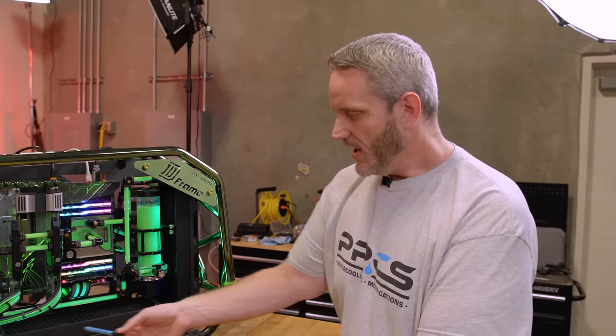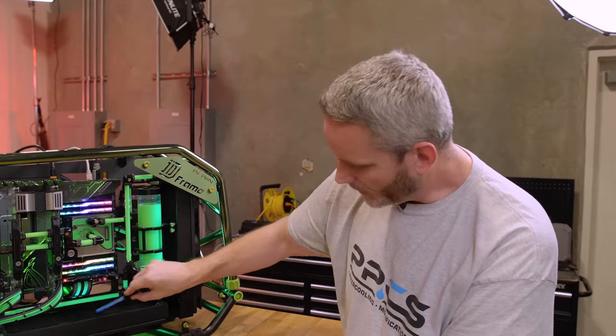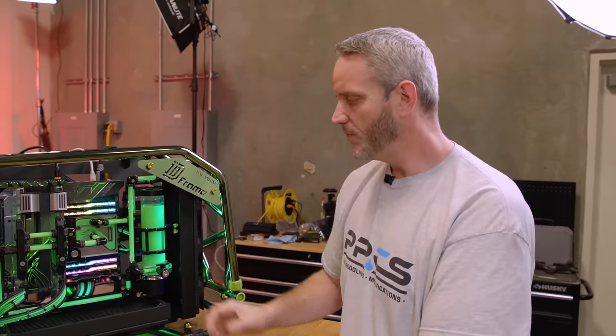and the radiators. That's the other thing people tend to forget about: there are thin rows that go down the radiator, those are referred to as rows, and that's where the fluid flows through. And that's thin and restrictive as well. And it's rough in there because it's just brazed copper, right? And so it's not real smooth.